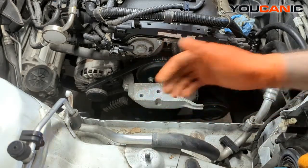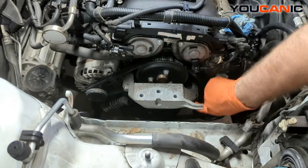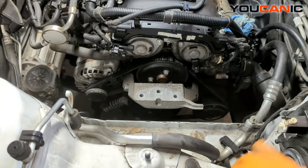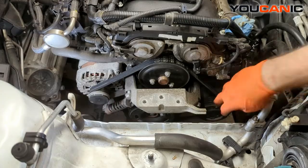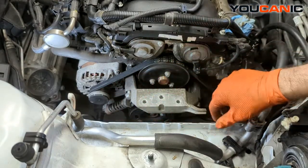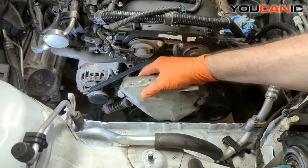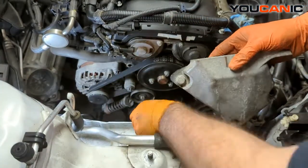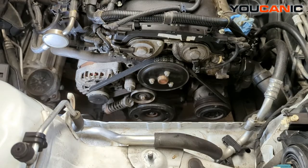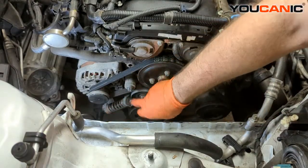We can do a good inspection of our motor mount to see whether we need to replace the rubber grommets in there. If you needed to take this portion off, that's another three bolts that go around there — they are still size 15. I've gone ahead and removed those three bolts here and worked the mount out. Now we have the whole motor mount out, and we can see the way our serpentine belt runs and the tensioner unit on this vehicle.